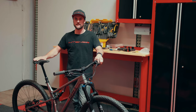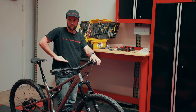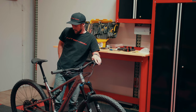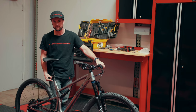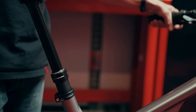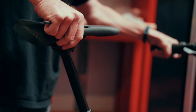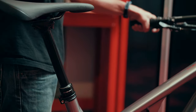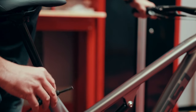Let's take a look at our saddle height. A little tip: place your hand karate-chop style right on the top of your hip bone — that's a really good rough gauge of where your saddle height should be. On our 951XC, there is a seat post clamp that uses a 4mm Allen. Loosen it maybe a turn and a half to two turns — that's more than enough. From there, gently push our post down with the seat up. Use that same karate-chop method to check your saddle height — and that's actually pretty much right on the money. Snug it into position.